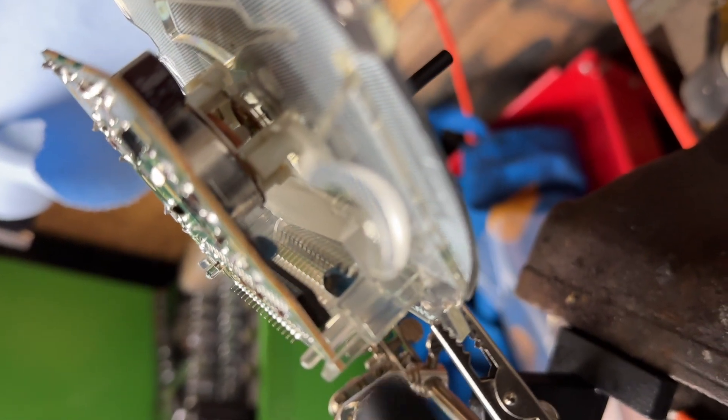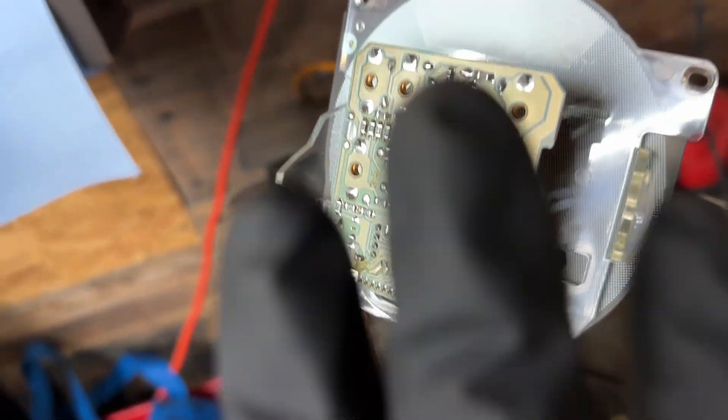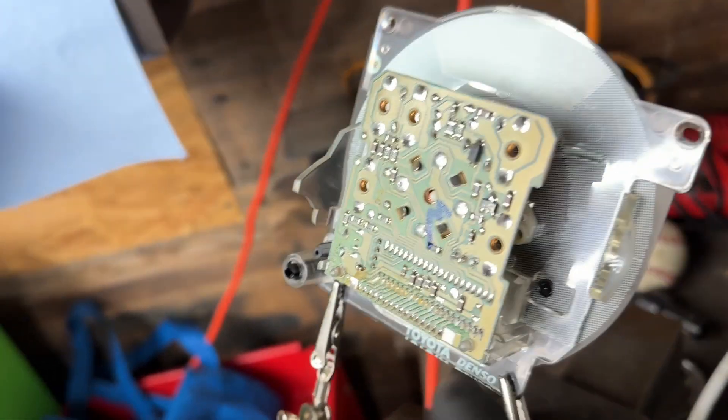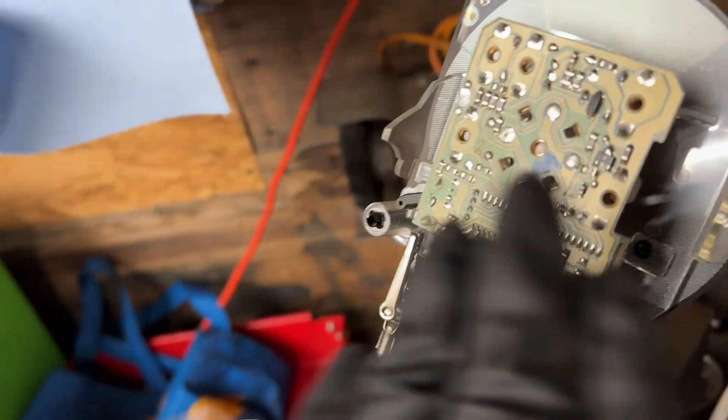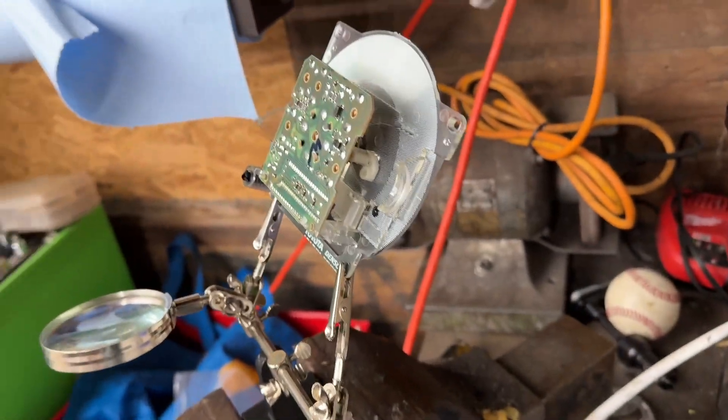I just wanted to show you what I did. Like the guy who discovered how to do this, I bent mine back and forth till it fell off on the inside. But unlike him, I did not solder it to the back. I cleaned off those solder points and pulled out what was left of the little tabs on the old one. As you might expect, the spacing on the new ones is the same as the spacing on the old ones, so it very easily soldered right in — went into the holes that I cleaned out. Then I just bent one of them over to hold it in place while I soldered, added a little bit of solder, and soldered it back together. So I'm going to put it in the car and hope for the best.